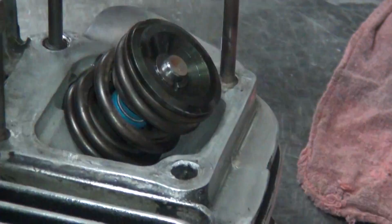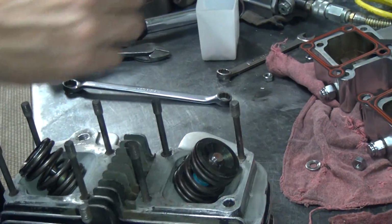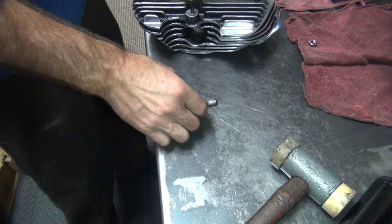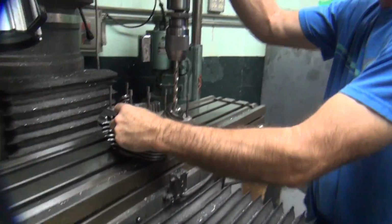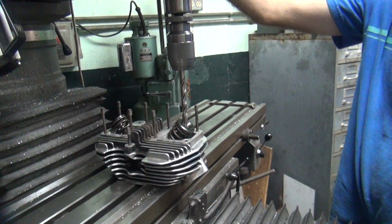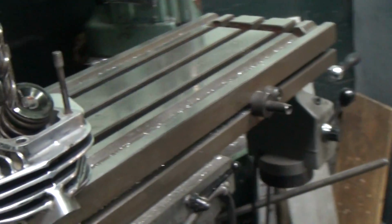Yeah, all the threads are missing. Well, there's the problem. The threads are all on the stud. Not in the hole. Yep. Alright, plan B. Or actually up to C now. We already had A and B screw up, so we're on C's. Alright, flip it off, let's go to the machine shop today. We got nothing better to do today. Nope. This is all free time. Yep. So this is 5 helicoils now out of how many is there? 12. No. More than 12. Out of 18.